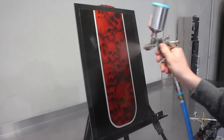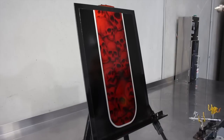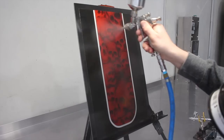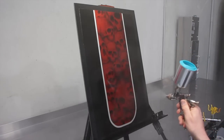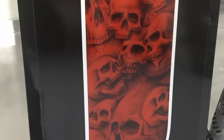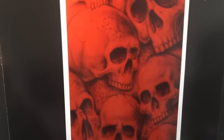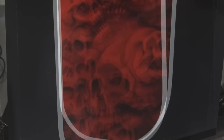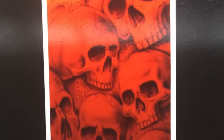All we need to do now is one last coat of Intercoat Clear — this time in my LPH80. I wanted to get a really decent wet coat; you can see this pretty much simulates almost a two-pack clear, at least for the camera. Nice and careful with your passes, just get that on nicely. And that's it — you can see all the skulls rendered, the candy applied over the top, and the silver pinstripe. Thank you for watching, hope you enjoyed the video, and we look forward to seeing you next time for another Airbrush Asylum how-to video.